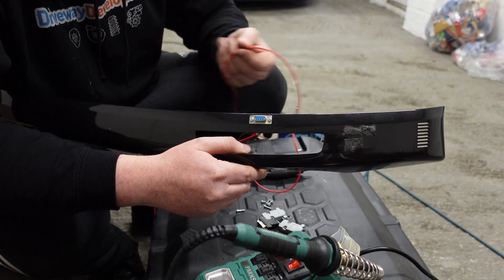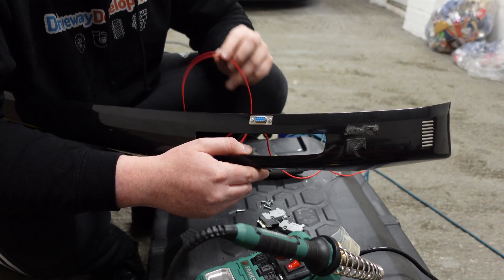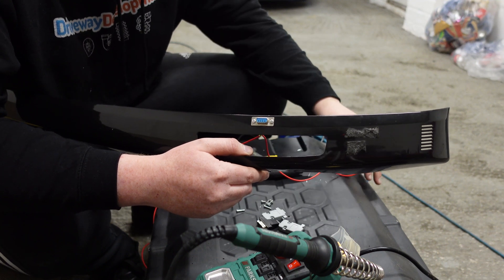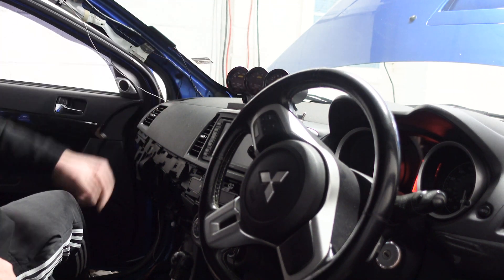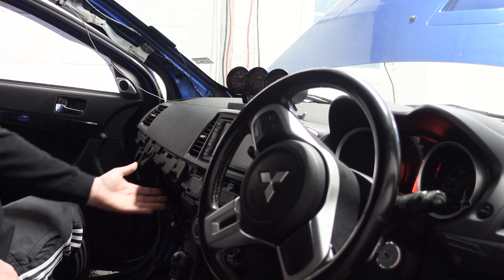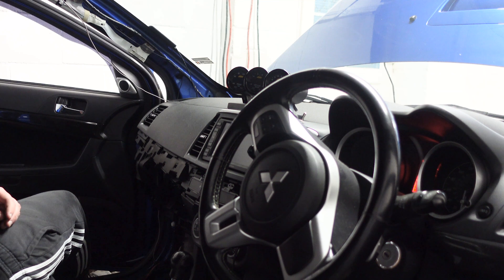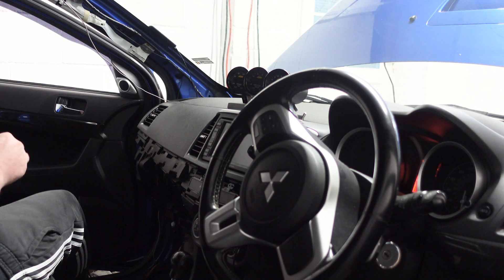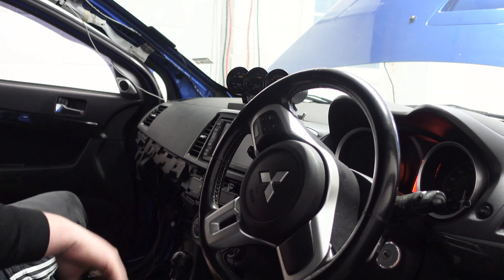I'm going to refit it, connect one wire to the ground and one wire to the five volts out of the wideband, and then it's pretty much done. I've just been tracing the wire that I ran from the air fuel gauge — it's actually under the glove box. So I'm going to put everything back together now, fit the new port, run the wires, then go to the glove box area and actually wire it in.